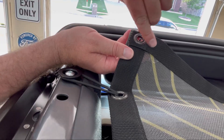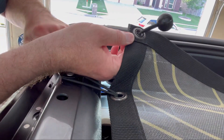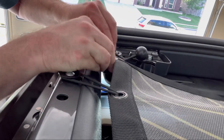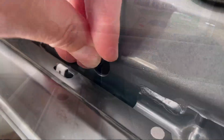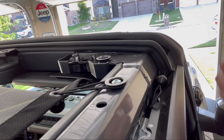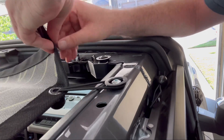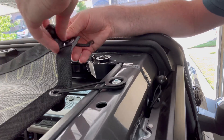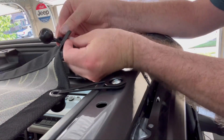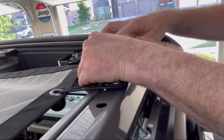Up at the front of the Bronco, put the small bungee cord with a little clip on it through the top of the gear shade, and a regular bungee cord through the bottom at the same time. Take the bungee cord with the small clip on it, pull it over the side and through this little hole, and do the same on the passenger side. The short bungee with a clip goes through the top, the regular one through the bottom — attach the regular one to the bungee anchor and the other one goes across the roll bar and into that little hole.